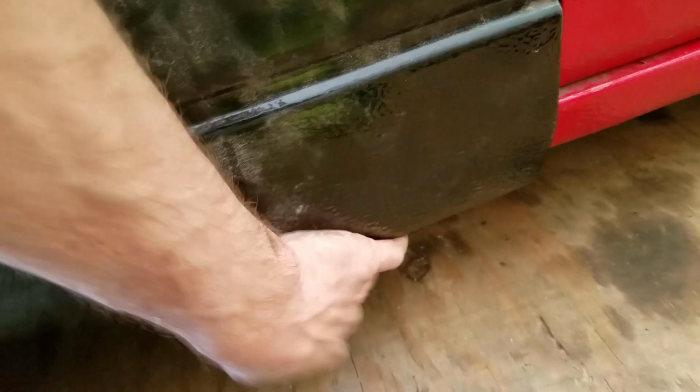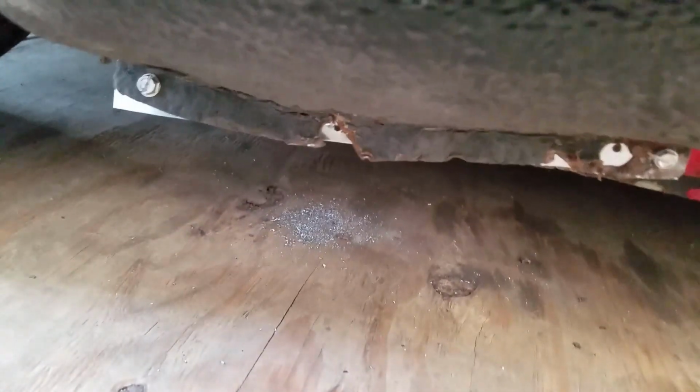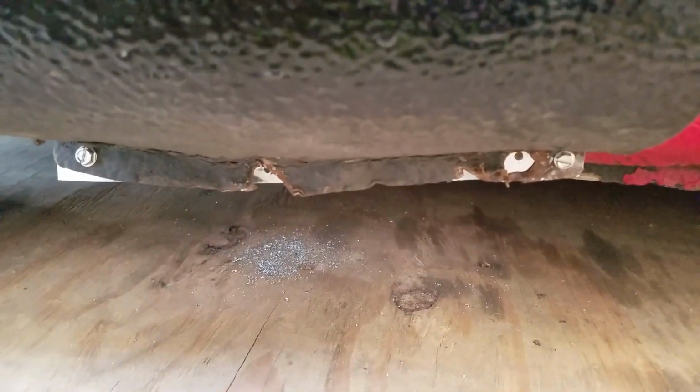All right guys, so with the fender on, basically what I came to figure out is that we will have to cut those screws that I just put in there. So the self-tappers, if I can actually show you guys. Those self-tappers on the ends, we will have to cut the backs of them off or shave them down or whatever. As you can see, I already pre-drilled the two holes in the sheet metal to fit the fender back up, but it's mint.